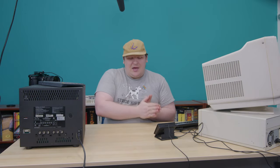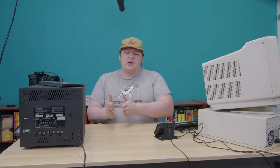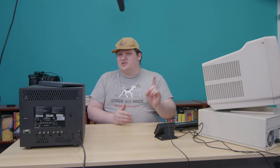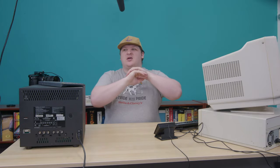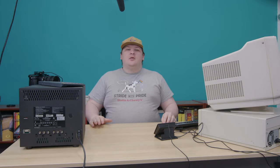And then there's another, because over in Japan, NEC was making computers, the PC8801 and 9801 series, and those also supported TTL video. It was almost identical to the PC, it was RGBI, except two things. One, the PC ran at either 15 kilohertz or 22 kilohertz. The PC88 and 98 ran at 24 kilohertz. You cannot buy a 24 kilohertz monitor. They do not exist. They were never made for any other purpose that I am aware of, just those two computers.